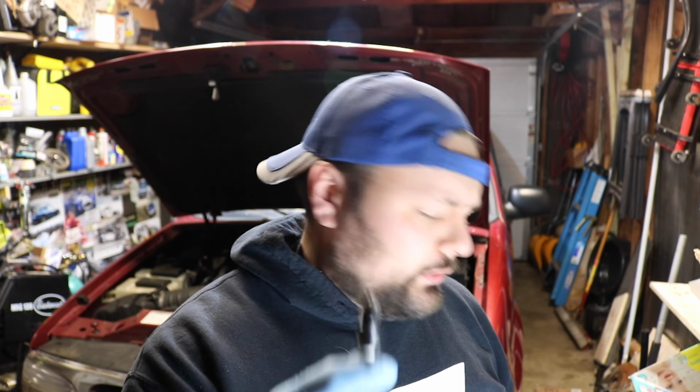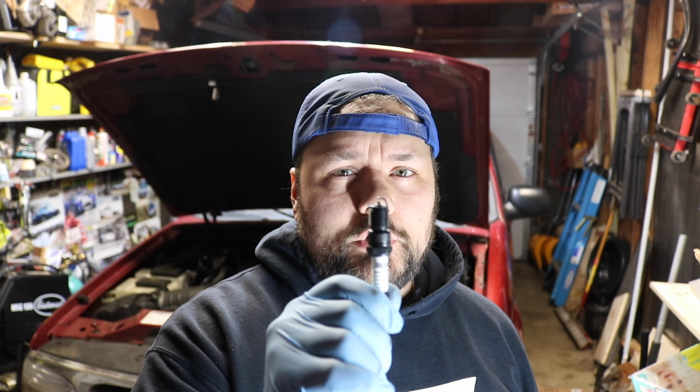And the spark plug gap plays an important part in the running of the vehicle, because the larger the gap, the stronger the spark has to be to reach the electrode. Now, if it's too big, you can overstretch your coil. If it's too small, the spark's not going to be big enough to light your combustion efficiently. It'll probably still run, but not efficiently. Conversely, I have seen these where people have dropped them and smashed the electrode completely down, and so this doesn't generate a spark at all, and you will get a misfire at that point. So, just little tips on some spark plugs.